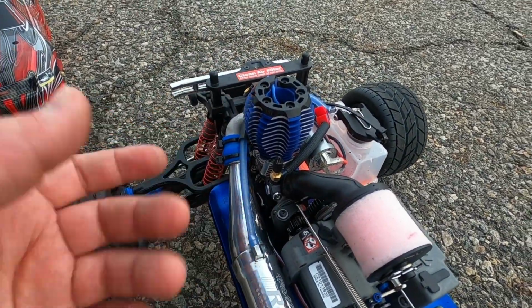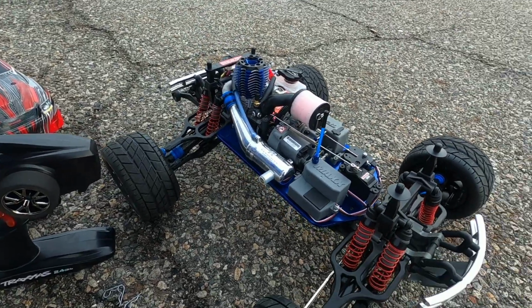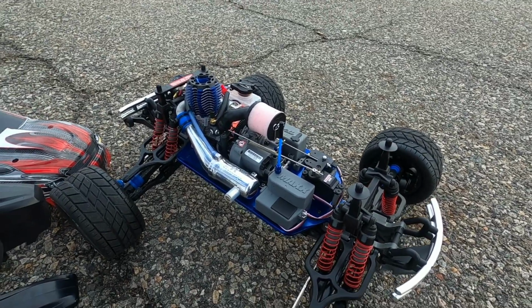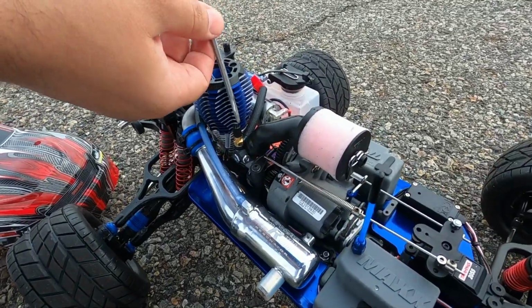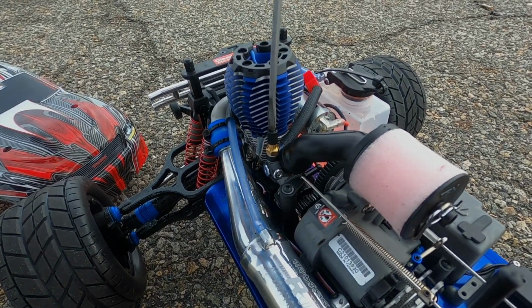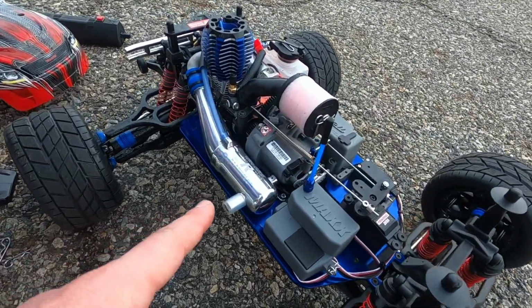It's a little hot. It's all right. It does bog down on the hot, high side. Yeah, I noticed. That usually means it's not getting enough fuel. So maybe it's too lean. Okay, so riching up the top end a little bit? Yeah. Riching it like a quarter turn. A little more, do more. Yeah, the idle is great now.